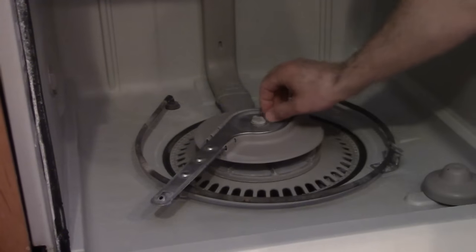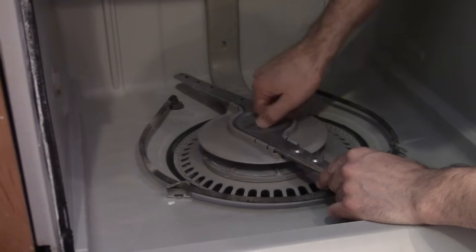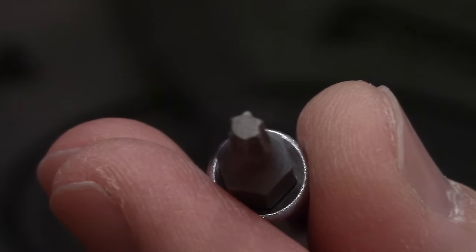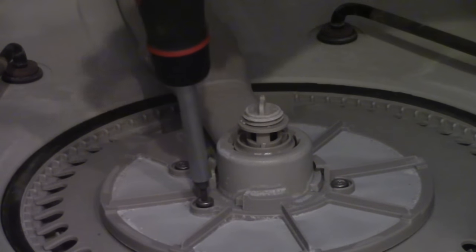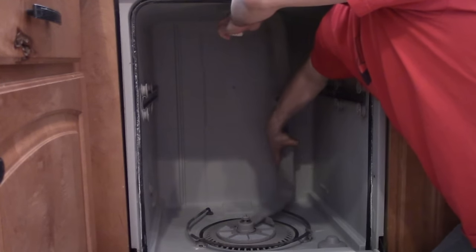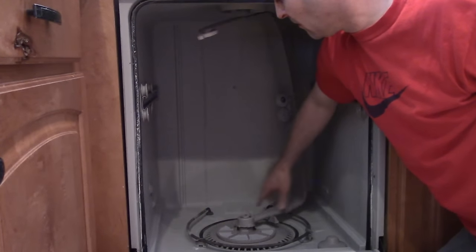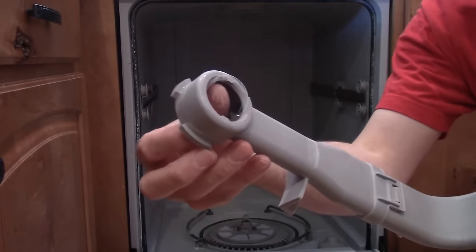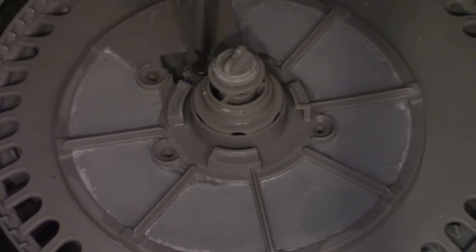There's a screw in the back and a screw in the top. If you happen to lose those screws, they're stainless steel, so you're going to want to find stainless steel screws to replace them. The lower sprayer comes out by unscrewing the part in the middle — it pops right off. I'm using a T15 bit to take out the four screws; three of them are visible and one is hiding behind the arm. Your arm should be free to move now — turn it about 45 degrees and lift up, and it should come right out. Somewhere there's going to be this little plastic ring; you want to hang on to that, don't lose it.